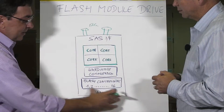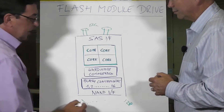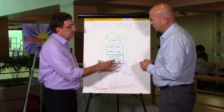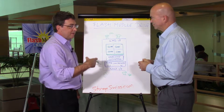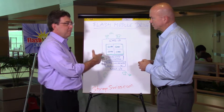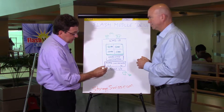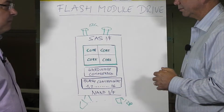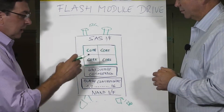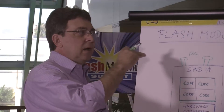Interfacing to the actual NAND flash, you have many — up to 128 NAND chips. In a normal FMD there are redundant flash controllers to drive the on-die interface to drive the actual NAND flash. We've built out 16 of those; most other implementations I've seen max out at about eight. And then each one of these actually has two paths to NAND flash, so it's 32 redundant paths. With this multiprocessor architecture and the parallel interface to NAND flash, we don't really hit a write cliff — our write cliff is more like a write hump.